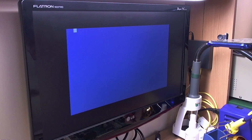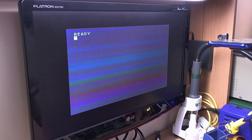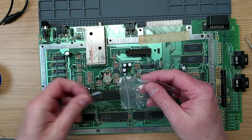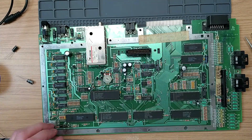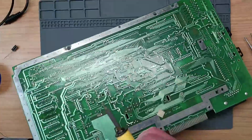It boots! That was easy. But what about the video problem? The owner said it was intermittent. Maybe since we've had this machine running for a while the caps have started to behave themselves - but here we go, look at this. That's really bad. Let's change these capacitors. We've got a set of replacement caps that I ordered - they're a little bit smaller than I'd like and not quite the right form factor, but they are the correct value.